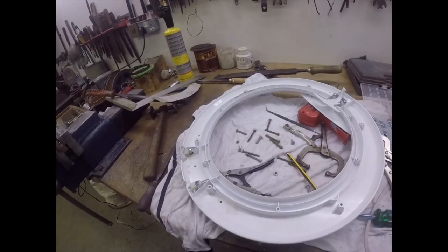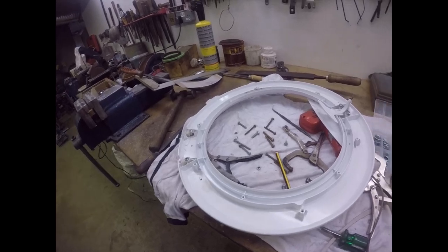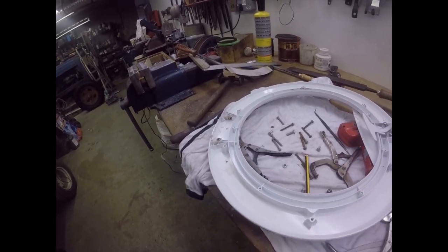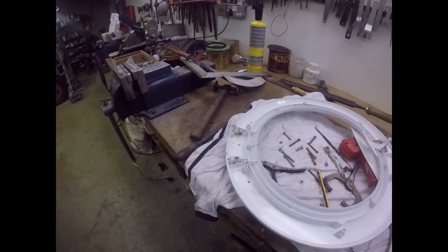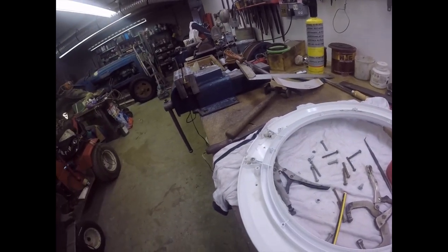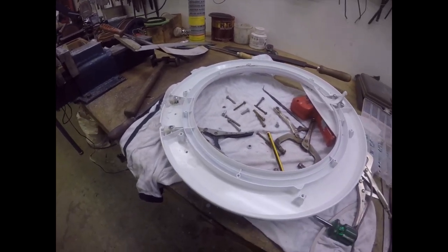Good morning people, Tuesday. Last night I attempted to fit a new pump to our washing machine — a job I've done thousands of times — and it decided it wasn't going to work and it was going to leak. I went back to it this morning and saw straight away why it wouldn't run: I'd only plugged one tag on a two-tag connector. I plugged it on one side because you can't see in there — that's my excuse. The leak was just a hose not seated properly, so I got that working fine.